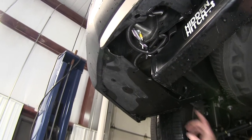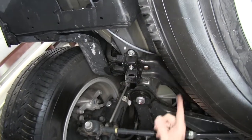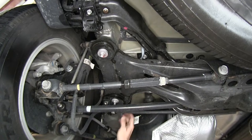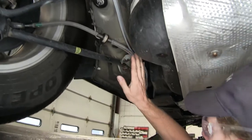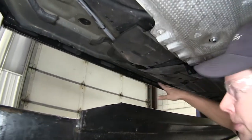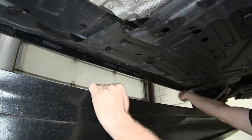We'll show you how we ran our wire. Starting here, we went over this plastic panel, underneath the frame rail and above the subframe for the rear suspension. On the very top, there's a small tab you have to feel for — use that as an attachment point for zip ties. Continuing on, we went behind a line here, down until we hit the parking brake cable and just zip tied to it. After that, we tucked it underneath the panel, and you can access the fasteners from the outside to thread the cable all the way through, letting the panels do the work.